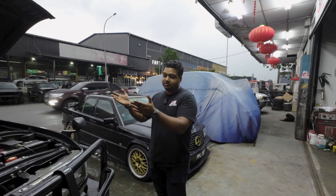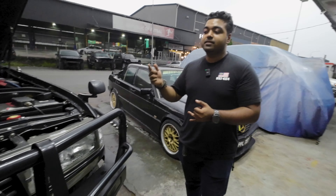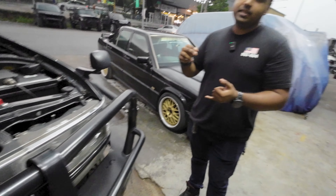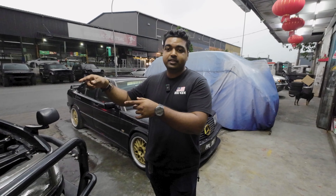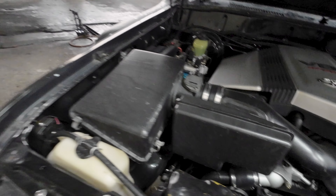Although a lot of people wouldn't register it, the owners we work with enjoy having a legal vehicle on the road. The fuel tank also came from the 100 Series, and the fuel pump we're using is actually from an LX570. For the cooler, as I always tell people, the one thing that will kill a gearbox is heat — so it has twin PWR coolers in the front. We run PWR on almost every one of our builds. For the radiator, it's still an 80 Series size but the input and output have been configured to match a 100 Series, so you can just pick up 100 Series parts off the shelf and you're good to go.